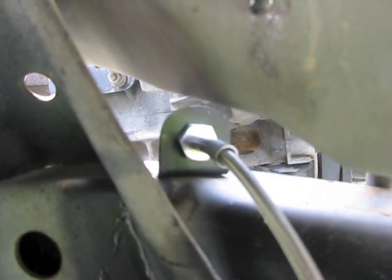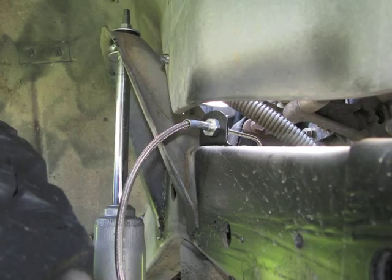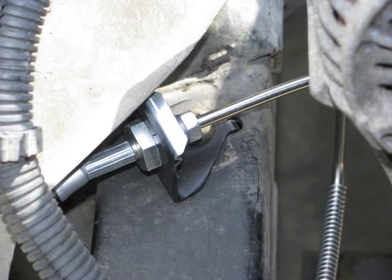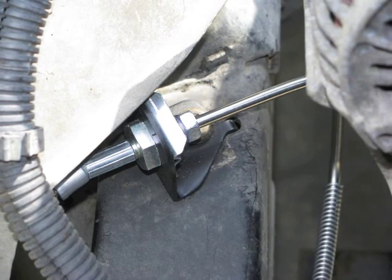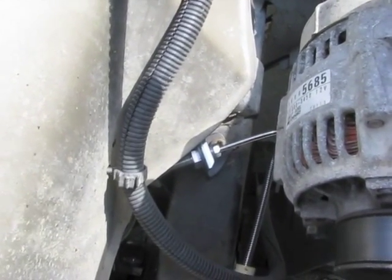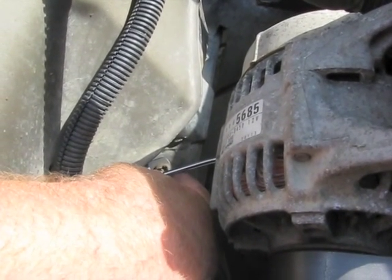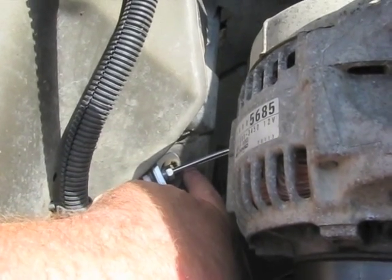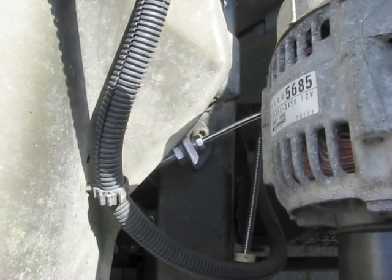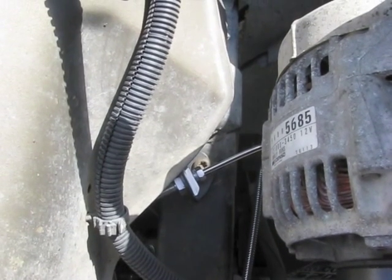I'll try to show you a little top view of that. I basically just bent the bracket into a little 90-degree angle and of course rounded off the edges. I did make a little pin that goes into this little locating hole, just like the original brake lines did, and it worked out pretty good — that'll keep the bracket from spinning around on me.